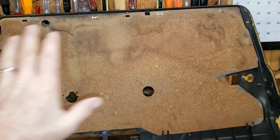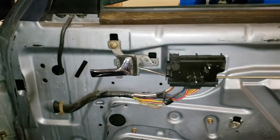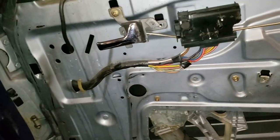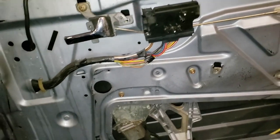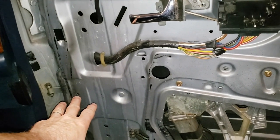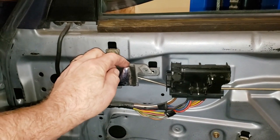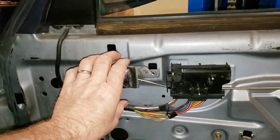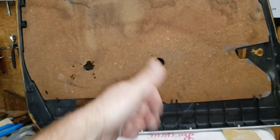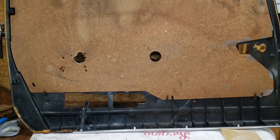Once we get this door panel squared away and ready to go back on the car, we still have a couple of things to do on the inside of the door. Coming up in future parts of this front passenger door series, we have to take out this check strap — it's just a little bit too stiff, doesn't make any noise, it just needs some grease. I need to pull that out, clean it up, and re-lube it. There's also this typical little problem here — maybe just worn out, maybe I'll add a little bushing. Can't be too hard. That's all for now — appreciate you guys stopping by, don't forget to like, share, and subscribe, and click that little bell to be notified of new videos. Remember: enjoy driving your classic Mercedes.